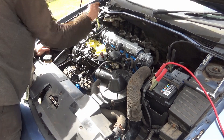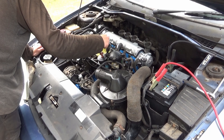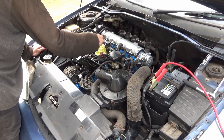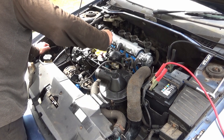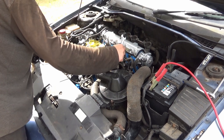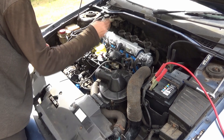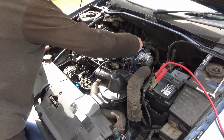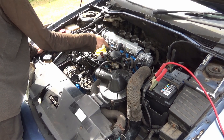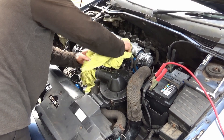We've got fuel there — that's fine, fuel at number one. Shouldn't take as long to get fuel elsewhere now. Fuel at cylinder two. Got fuel there. And that's number four with fuel to the system — lovely. All four now have fuel running through the injectors, so we know there's fuel going into the cylinders. Stage one complete — make sure this is all wiped down nicely.